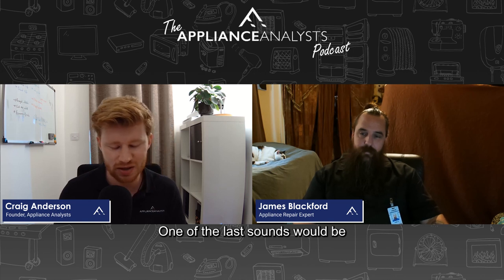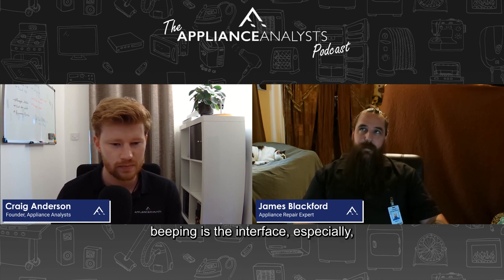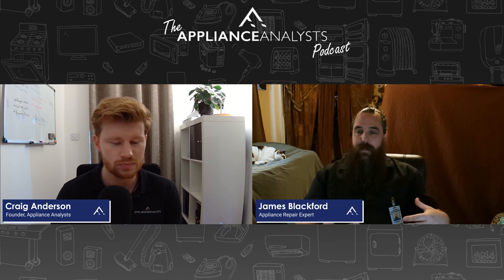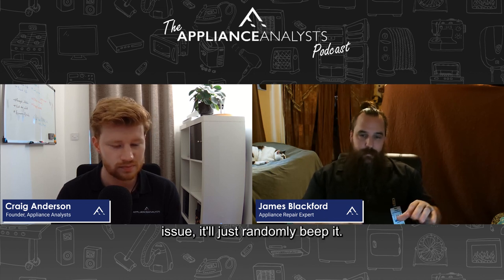One of the last sounds would be if it always seems to be beeping for whatever reason. This could be beeping during the cycle or at any other time. Is that generally tied to any known common issues? The most common issue with the beeping is the interface. Most dishwashers nowadays have a touch interface, and a lot of them are really sensitive. So when the button control panel starts to develop an issue, it'll just randomly beep. It thinks that somebody's pressing the buttons.